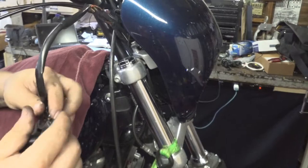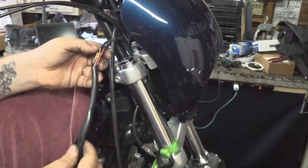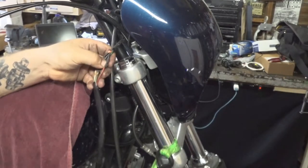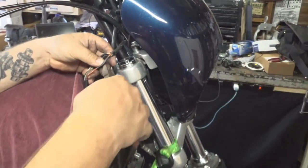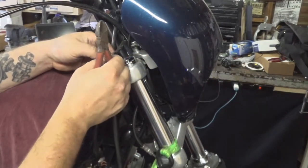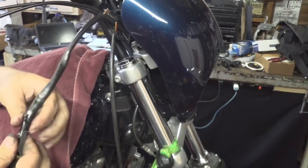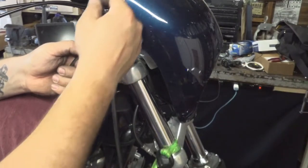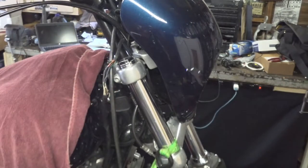Now I can peel this back and actually see which wires are going where. This allows me to match it up to the switch button — it's orange with a white stripe and a red with a yellow stripe. There's the red with the yellow stripe right there. I don't like to reuse solder joints, so we're going to cut it right at the solder joint. In order to get the wires back through this sheathing — especially past this bend — what you can do is take another wire, crimp it on, and use it as a pull wire to pull it back through the sheathing.